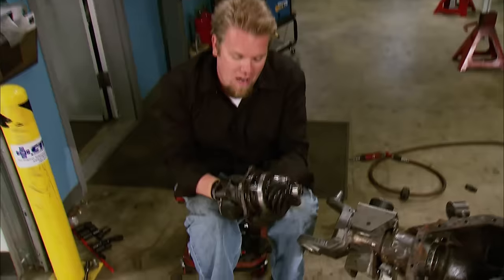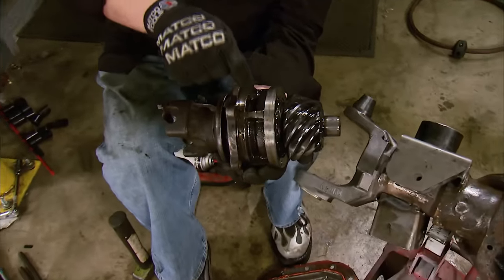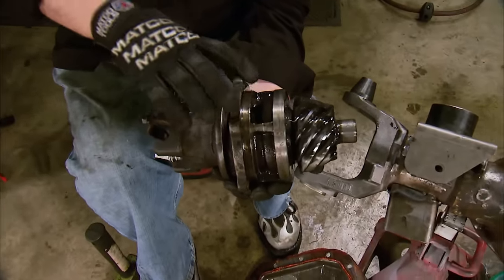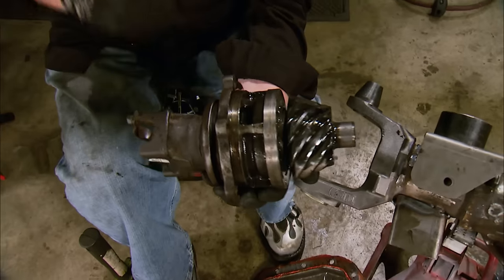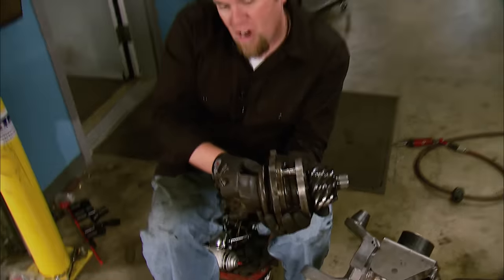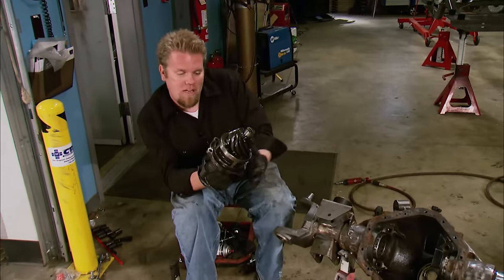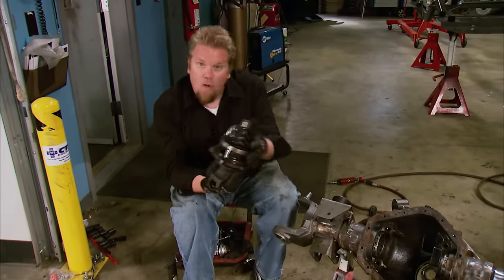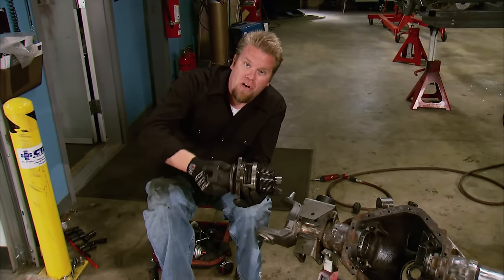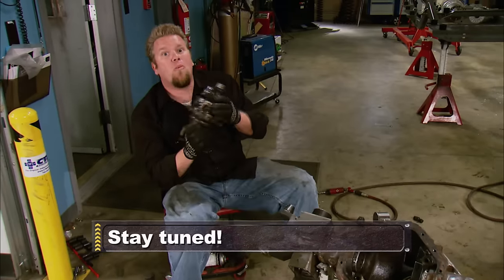The last feature is not really a strength feature, it's just an easy-to-rebuild feature. The pinion is housed in a pinion support with a crush sleeve inside that collapses to set the pinion bearing preload. If you're working in a small garage and don't have an impact strong enough to start crushing that crush sleeve, all you need to do is take your new pinion, the bearings, and a new crush sleeve to a differential shop. They can set up your pinion bearing preload for you, and you can just bring it home — making it really easy for the home builder.